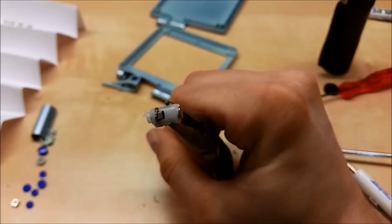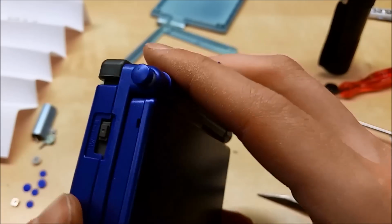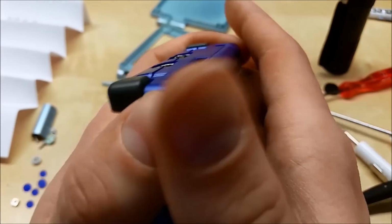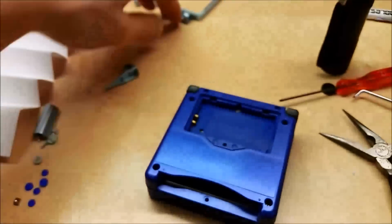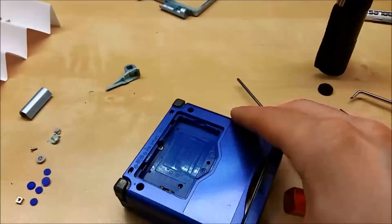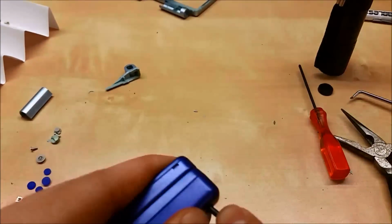So when I popped out those hinges, I wasn't totally sure of the orientation the case was. So I used some pliers to make sure I had it in the closed position, and you can put it in either way, so it'll fit in 180-degree increments. As long as you have it closed and aligned with the notches cut out, the hinges will match up just fine.